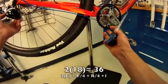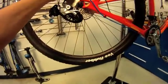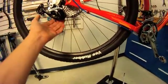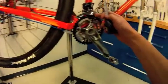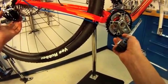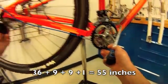So if we have 18 inches sprocket to sprocket: 18 times 2 gives us 36 inches from the top, 18 from the bottom — 36 there. Our formula says take our largest sprocket divided by 4, and our largest chain ring divided by 4. The math is easy again: 36 divided by 4 is 9 inches of chain here, and 36 divided by 4 is 9 inches here. So we have 36 inches plus 9 plus 9 — that's 54 inches, but that's for a one-speed. We do need the extra inch, so that's 55 inches of chain in our scenario.